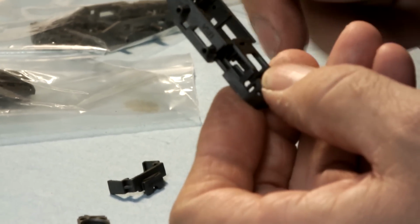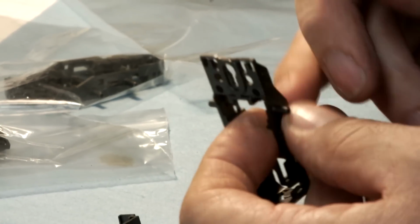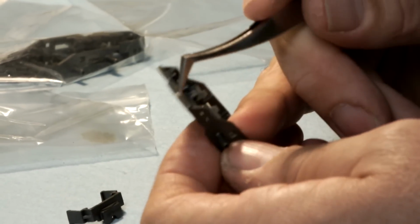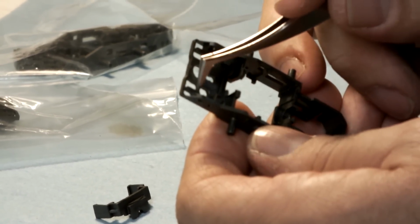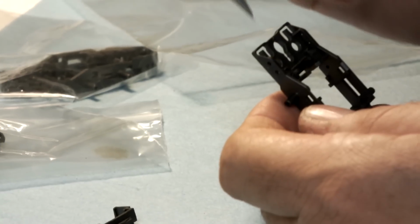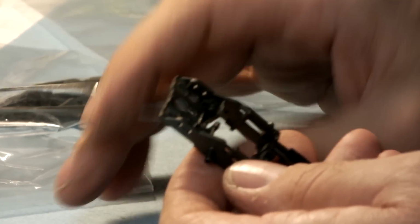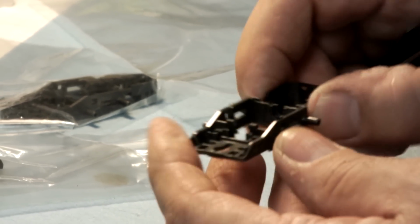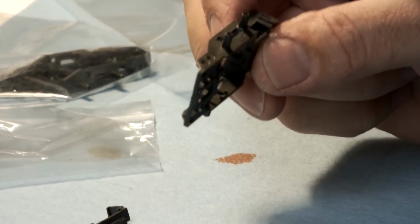We've got the bumper system on the front, and one of the things that was discussed is it might actually be possible for some pro racers to come in here and drill tiny holes all the way through into the keepers, so once the shoe is in the car you could put a keeper pin through that, to keep that shoe from going anywhere in the event of a really hard crash. That might be something that would be of an advantage in the drop-in Neo class.